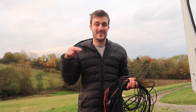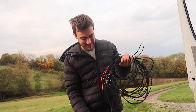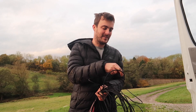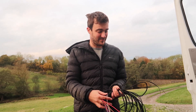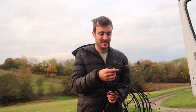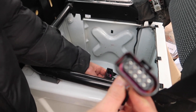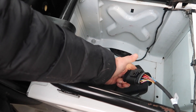So the last thing to do under the van is to run the two wires to the fuel pump. Basically all it is is one plug to plug into the heater itself, one set of wires to plug into your control panel, your positive and negative wire, and then the two wires that go to the fuel pump. It's scary when you first look at it but it is only four connections: one to the heater, power, controller, and fuel pump. So let's run these wires through a little hole next to the heater and into the fuel pump. It's a D-shape so there's only one way you can actually plug it in — you just push it on, snap and it's in. Easy.